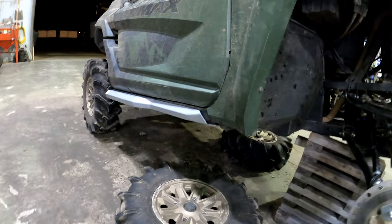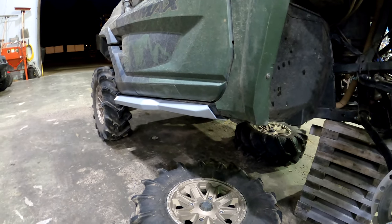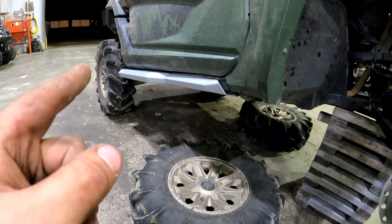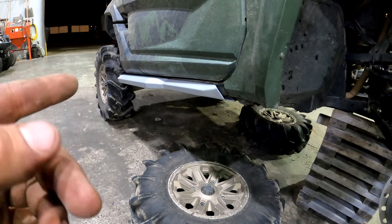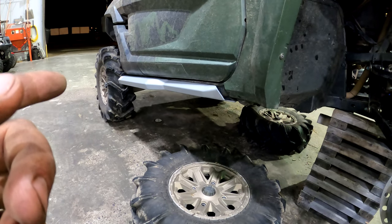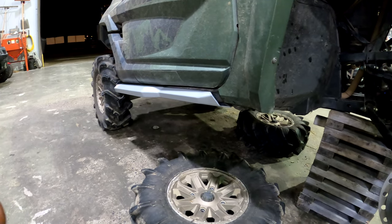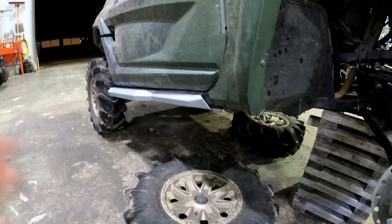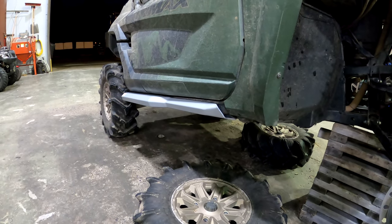All right, well, I got the passenger side on. It went way faster than the driver's side. I just pre-reamed the holes out in the back here, the three little holes, just to make it a little bit simpler so that I don't need to worry about them. Reamed them out, glad I did. It fit in like no problem. Front fit in as well with no problem. This side literally took like 5 minutes. The other side I spent way too long on.